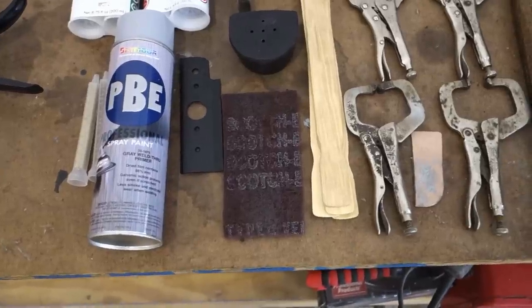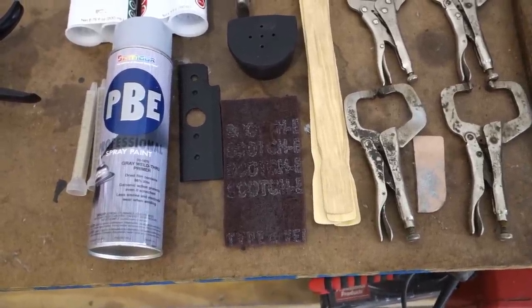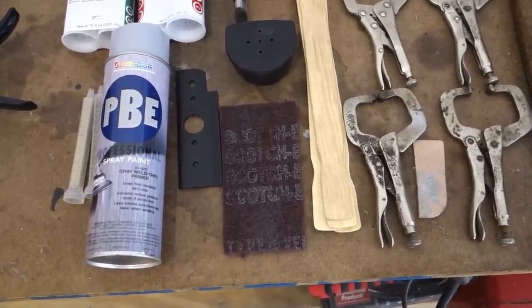This red Scotch-Brite is for scuffing the door skin in the fold area so that the adhesive has something to bite into. The 3M panel adhesive directions require the flange to be stripped to bare metal and the door skin can stay in primer, it just needs scuffed up. So that's what we're going to go ahead and do. Let's get to it.